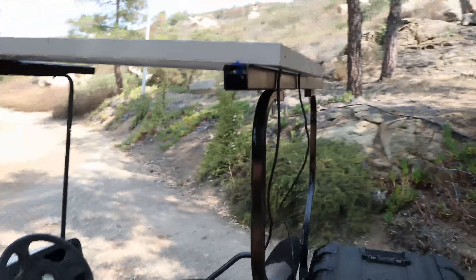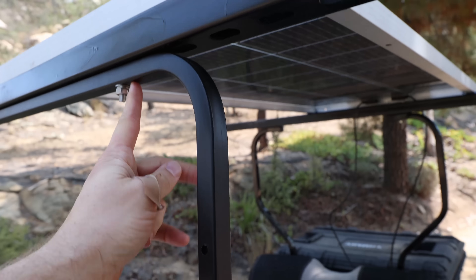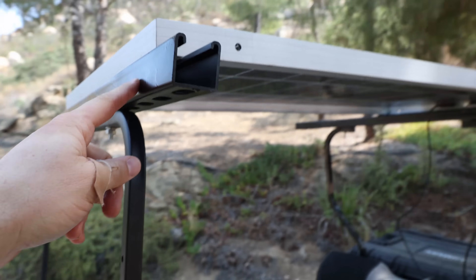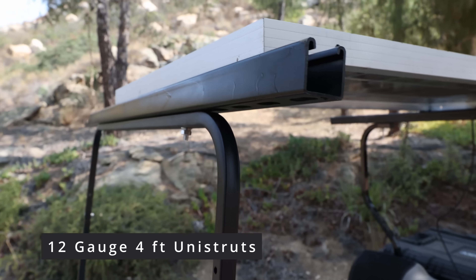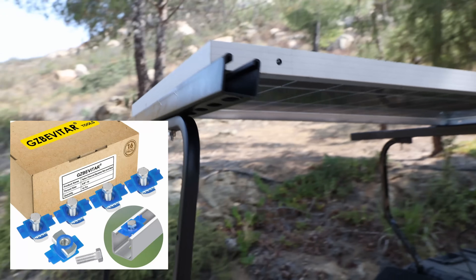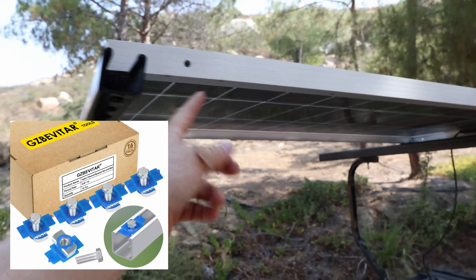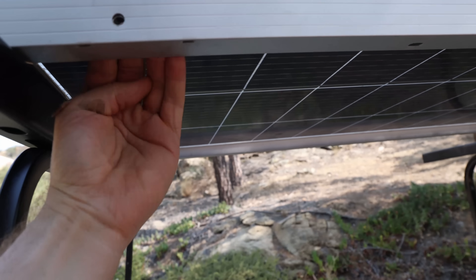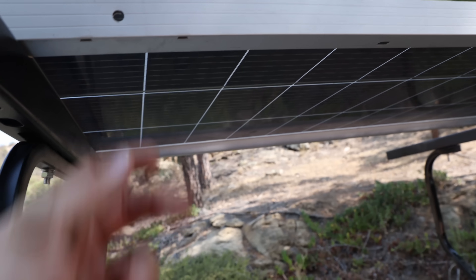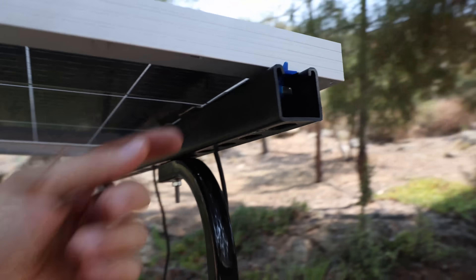It's very, very simple — those struts, rear struts, front struts, are the standard struts which come with a golf cart usually when you have a roof. Additionally, because I don't have a roof, there were already some holes in the struts, front and rear. I painted those unistruts black — those are, I believe, 4-inch — link in the description below. I did a little black paint on them, and I also ordered some unistrut nuts. I drilled some more holes in the aluminum, put a little wood in between, so nothing is touching the panel or destroying it. I did it up front and the same in the rear. Then you tighten it from below — that's it. That's how it's connected.